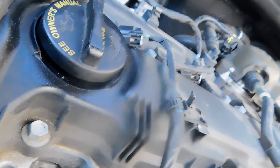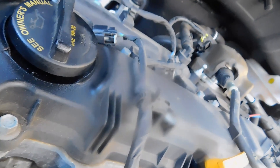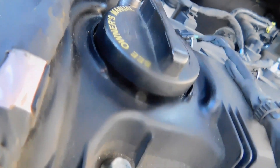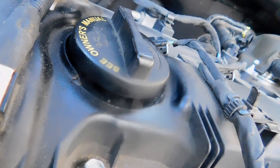Could be a relay, but either way, when I checked my battery, my battery was really low. So now I'm going to check the alternator. If the alternator is low as well, we may have to do the alternator, the starter, and the battery. Who knows what kind of tune-up or maintenance was ever done or wasn't done to this vehicle, being that it was a rental company.